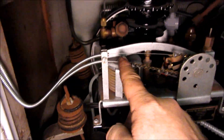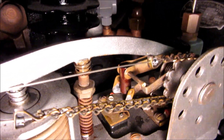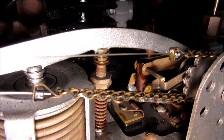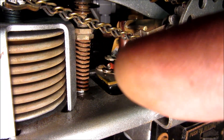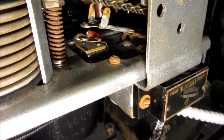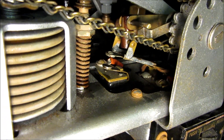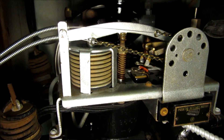connected by these two cables to this wheel — there's a little sprocket wheel behind there, you can see. When you turn the knob, those cables pull the chain. Right in there you'll also notice the electrical contacts; they're open right now because it's in the off position, and this arm is lifting the pin up, forcing it off.